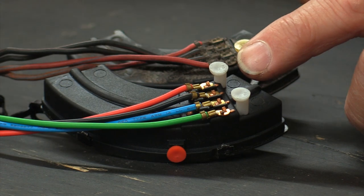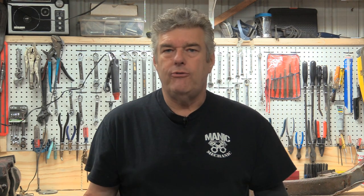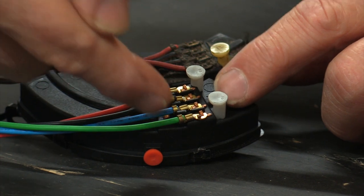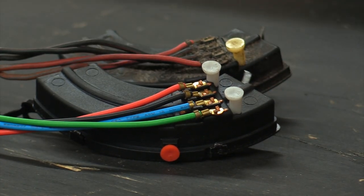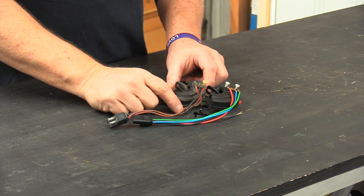The thing they did differently is the wire color looks almost like a turn signal harness color. If you were trying to go full concours-correct, the two center wires should be black, and the outside ones red with blue. I'm not going to complain — I'm not going to run Cam over, I'm happy, and he'll be happy because we won't have problems with it starting anywhere on the shifter. Everything sits up copacetically.